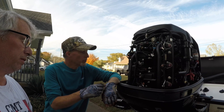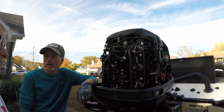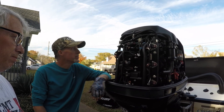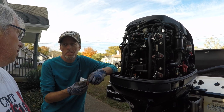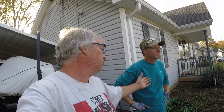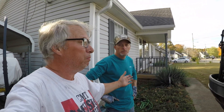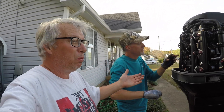I'm going to put the cowl back on and order a couple new coils, then pop the new ones in and change the plugs too because they look really bad. If there's a low cylinder, you may need more than one coil — I'd go through each one and ohm test them. The thing about these Optimax engines is that without a computer, it's really difficult to diagnose. You really need a good diagnostic computer.